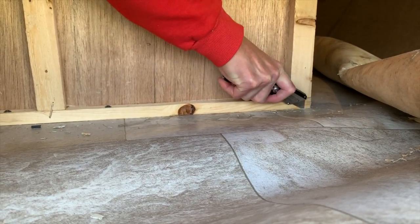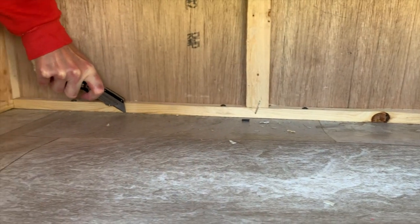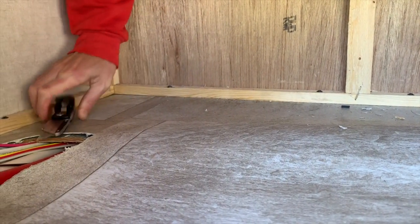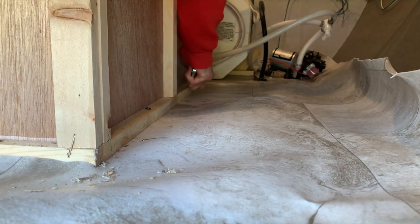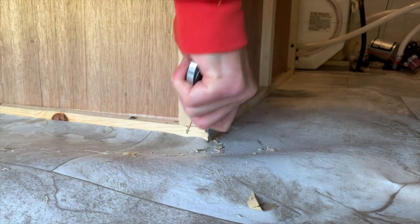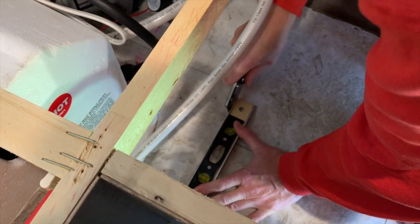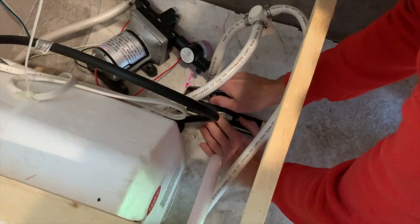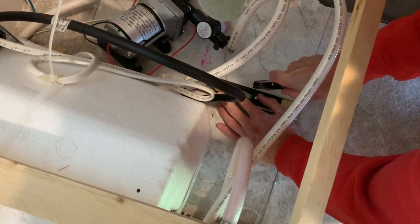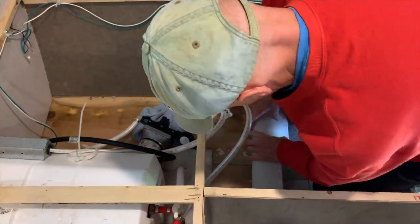First thing is to go ahead and cut the vinyl floor out of the cargo area. We had already cut the vinyl floor at the cargo door, now we needed to cut the flooring along the bed support and along the wall to remove it fully. If you ever have to do something like this, make sure you use a fresh blade on your cutting tool, cut slowly and try to keep the entire piece of vinyl floor intact. You can use the old flooring as a template to double check the measurements on the new piece to be installed later. I am using a small level as a hard edge when cutting along a visual seam in the flooring, to keep a straight edge on all the cuts. Once I finished the cutting, it was a simple matter of rolling up the floor to remove it. Be careful when rolling it up as it can split easily.